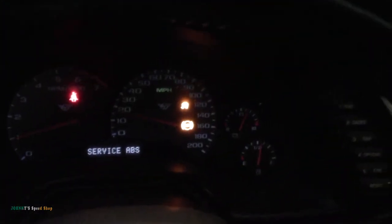So I just got this thing sitting on my lift. It's in third gear, doing about 25, 30 miles an hour. It's gonna throw an ABS code and all that crap. I'm gonna see. Oh, there's my ABS code. What's it doing? Oh, 20. So it's just cruising at like 20. I'll let it run for about 5 minutes. It'll warm up all the fluid enough where we can drain it and refill it. And the same with the diff.